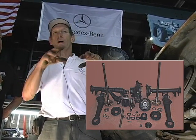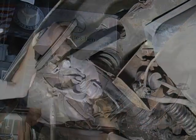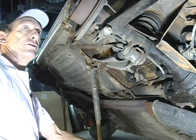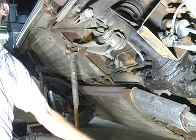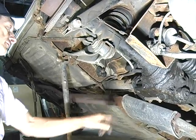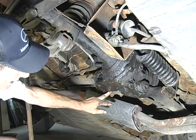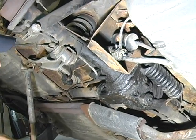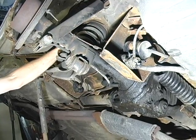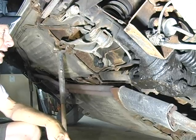Check the yoke assembly visually and freshen up some other things — maybe paint it, clean it, put bearing seals in it, and put it back up in there. There are a couple of rubber brake hoses you almost always want to replace unless they've been replaced recently. The front pinion seal is a common source of a minor leak — you'll see a spot when you park the car. When you have the unit out, you should also change the wheel seals, probably the bearings, the rubber mounting bushing, and the trunk mount up inside the car. The rubber spring pads top and bottom and the rubber mount on each side of the trailing arms — all things to think about changing. None of it is real expensive, and it really improves the ride quality of the car.